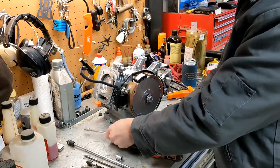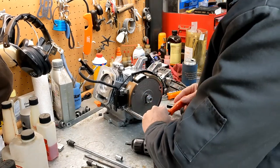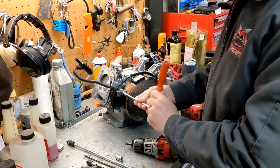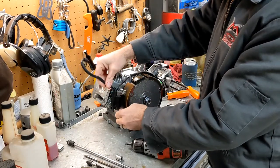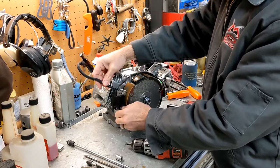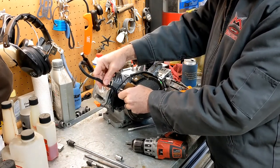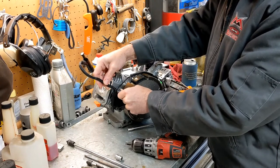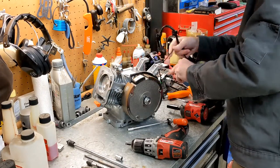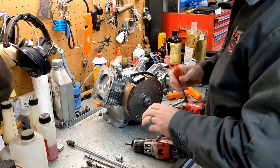We'll also go ahead and take the coil off. Like I said, it probably won't hurt anything, but let's take it off. We have to take it off anyway because we're putting a different flywheel on here, and the odds of this flywheel and the replacement flywheel being exactly the same diameter are low. And you've got to reset your clearance anyway for the coil. I'll take these 5-inch long screws out. Okay. Get that out of the way. We'll just set the coil out of the way. We don't need it right in here. Okay. We got that on there. Get all this junk out of the way.